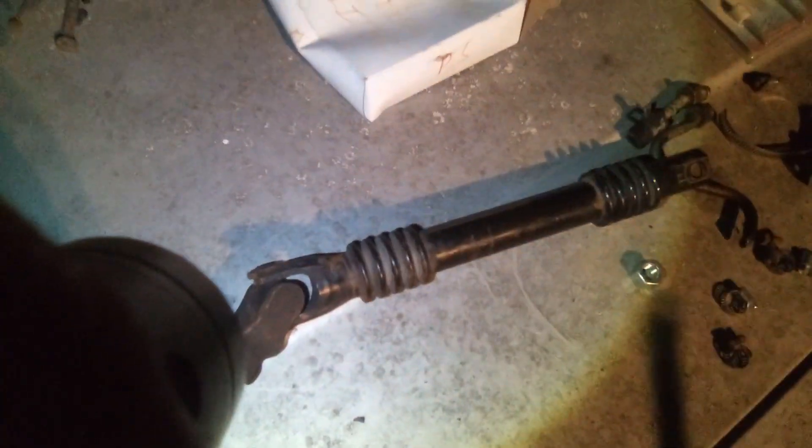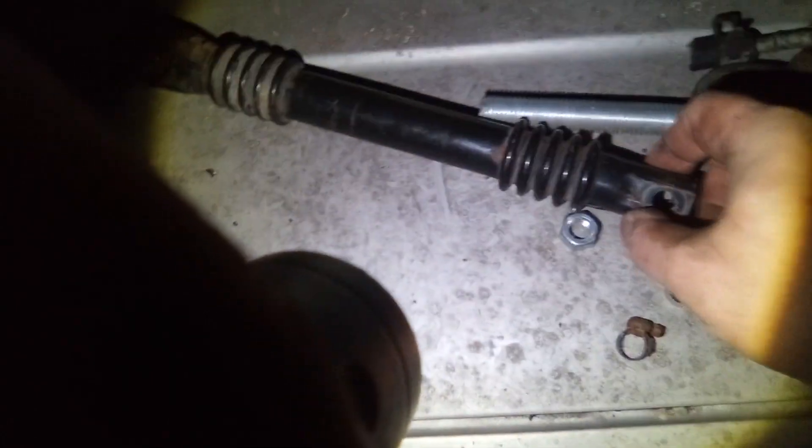What I've got here, I've got a couple things to test. I've got a three-quarter inch piece of all-thread that shoves up in here like that. And I'm thinking I might weld on both sides of it and figure out something, or maybe grind a nut and put a jam nut on it so that this will turn — well, it won't turn in there. But it needs to be able to go in and out. So what has to happen is this needs to slide into here, and then this here needs to go up into the steering column, and then this needs to go out of here into that hole. So now let's see what size that hole is. I think I measured it as a three-quarter.